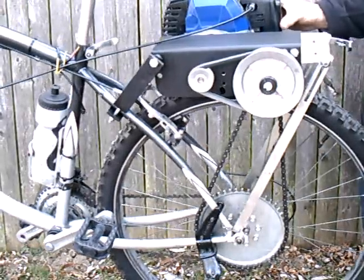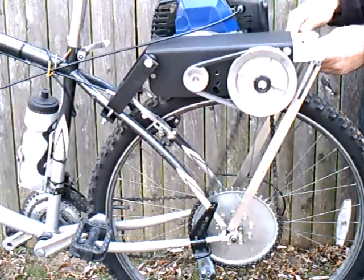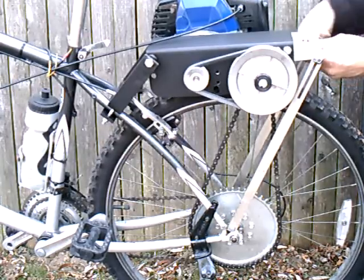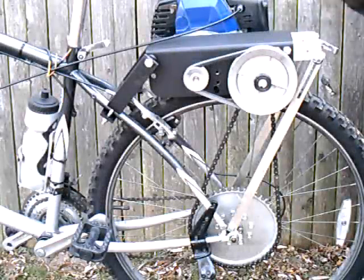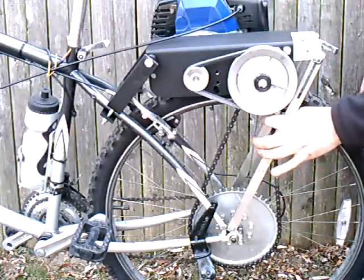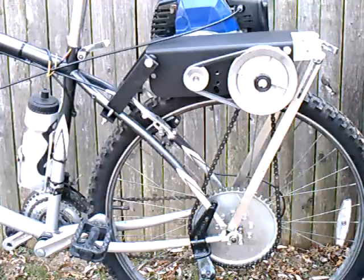I went ahead and installed the chain as you can see here. The kit comes with four feet of chain and you're going to have to cut it to the proper length. The easiest way to do that is to unlock the assembly and let the jack shaft rest on the tire, then measure out your chain and give it about an extra two or three links as a good starting length. That length will be tightened by the quick release and your rear support bars. The set screws on the U-bracket up front and on your drive sprocket are still loose — you have to line the unit up laterally, right to left, making sure the chain is not rubbing against your tire. Once you get that lined up, tighten down your drive sprocket set screw and your U-bracket set screws, otherwise it will come out of alignment and the set screws will fly out.